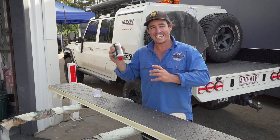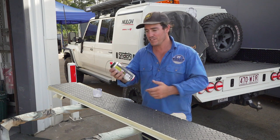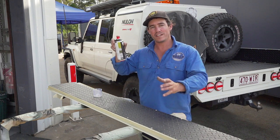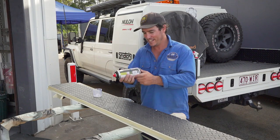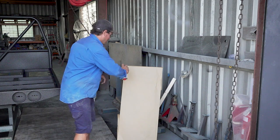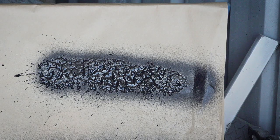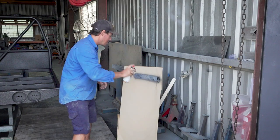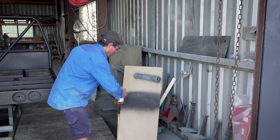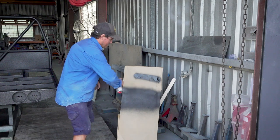After shaking for another two minutes, I suggest you get a bit of paper or board to practice on first — that's exactly what I'm going to do. You want to spray this at quite a distance. One of the main things to realize is if you treat this like a standard aerosol can it's not going to be a nice finish. You've got to put your hand back a long way and treat it like an underbody gun, because that's essentially what it is. So from a distance — just nice — look at that!